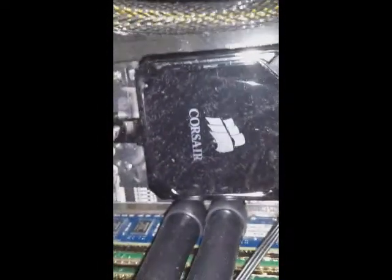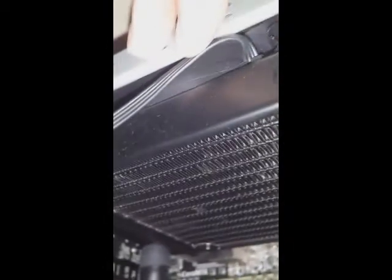The way I've got the system set up at the moment is that where the old 120mm fan was in the back of the case, the radiator that comes with it is hooked to that with the new fan instead, and I took the old fan and stuck that up on the top. So basically it's sucking in through the back and then pushing out hot air at the top, which makes sense as heat rises — and I have to say it was quite impressive actually.